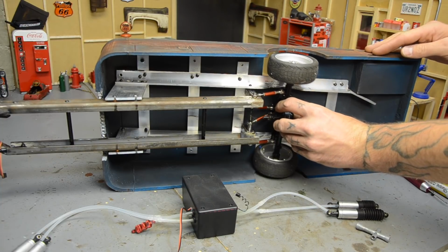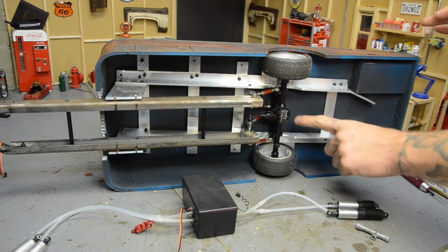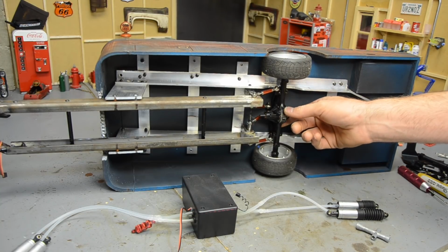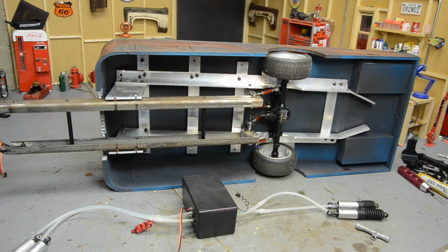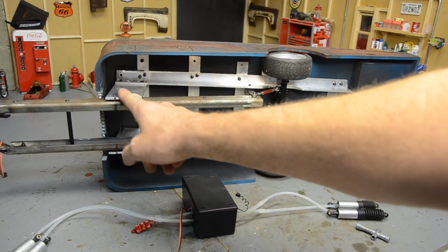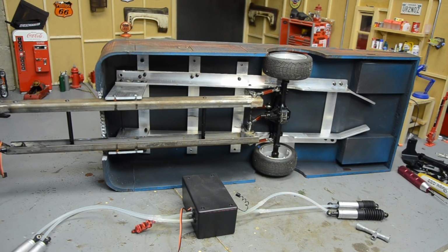As far as the cantilever mount, that is going to be the biggest challenge, because with this laid out, the RC four-wheel drive four-link mount, the truss that goes across the axle, is flush against the body. And even where I've clearanced the frame rails out right there, where the aluminum bolts to the steel, in both places, I'm running about a 3 millimeter spacer on both sides.